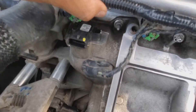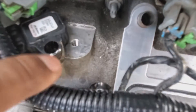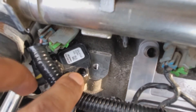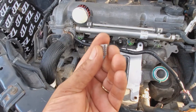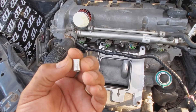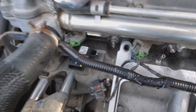For the 2.2s, when you have to put the MAP sensor on top of the manifold during installation, you can't really see it, but the mounting hole or tightening bolt is a little bit offset from the hole. So what I did in order for it to work properly without damaging anything is: the roll pin that's inside the MAP sensor — I punched it out with a center punch. That way you're right on par with it and it'll work just fine. I used a punch and a rubber mallet and it came out smoothly, and now I'm able to secure the sensor down without having to modify the hole or have the sensor twisted or crooked.